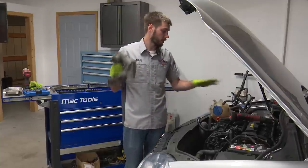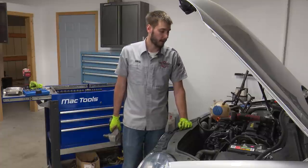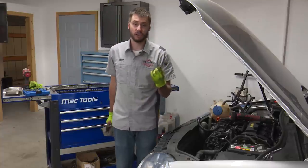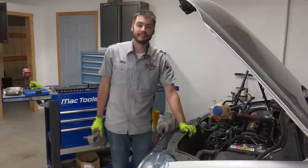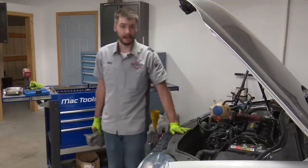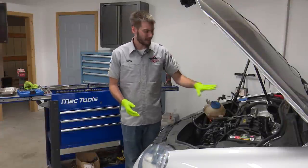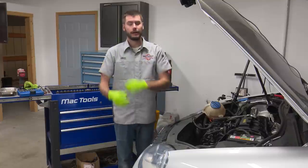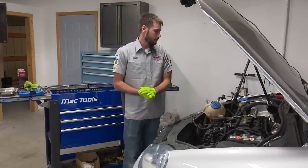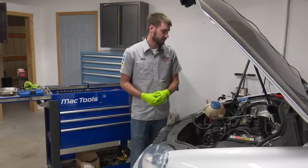So to get this big honking motor mount off the front of the engine, the engine's got to be basically uncomfortably high in the engine compartment at this point. I really don't like it being this high, but that's what you're going to do to get this out. Disconnect the exhaust, maybe at the turbo or wherever you want to, then disconnect that anti-roll bar underneath and unbolt that as well, and you can get it up this high. So with all the timing covers and engine mount out of the way - which by the way was way easier when I had the entire engine on the stand - it's time to remove tension on the timing belt and pull that belt off of the exhaust camshaft.